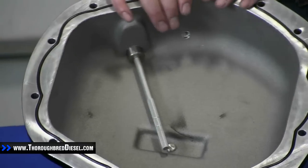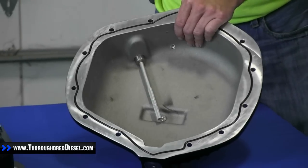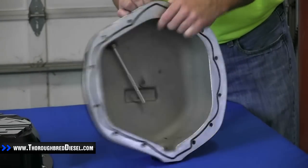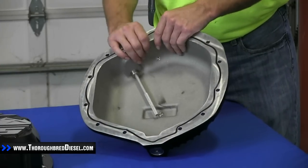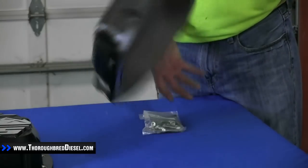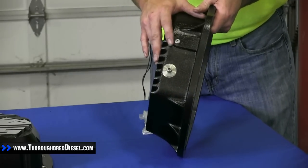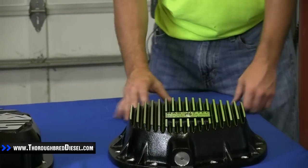One of the biggest questions about the MAG Hi-Tech cover is that it only uses 12 bolts — to make room for the drain plug and upper fin to make the cover more rigid. But it seals perfectly fine; the O-ring seal works excellently. It has a magnetic drain plug and what they call a calibration plug to check your fill level, plus a port for your differential temperature bung. It is cast aluminum aircraft grade.